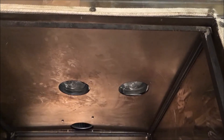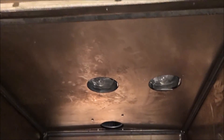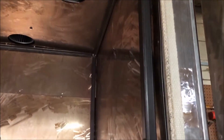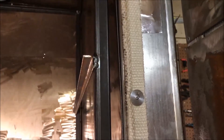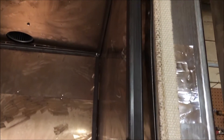As I was putting my rack in here I noticed that it was catching — it was too high, catching on the edge of the oven gasket up there. So I decided to go ahead and move that up a little bit. I also noticed I was getting some daylight through the sides, so I moved this one out as well. The fat part of this used to be set in like that, and I just moved these rivets out a little ways so that the fat part is in between the door and the stud there. It seems to be doing a tighter seal, so we'll see if that keeps it tighter and maybe helps it heat up inside a little quicker.